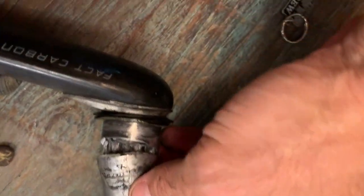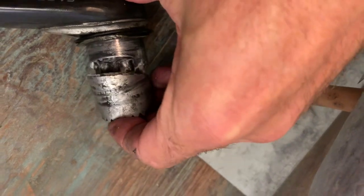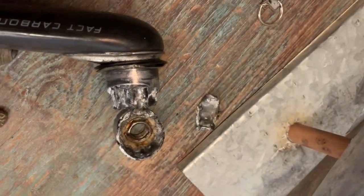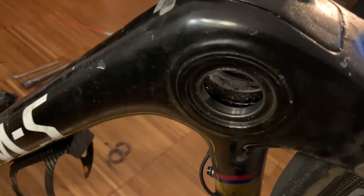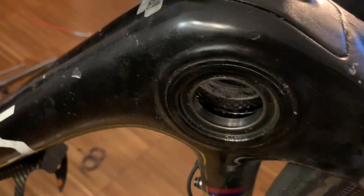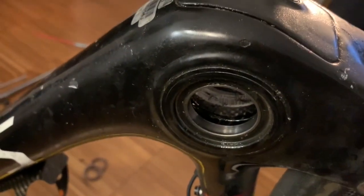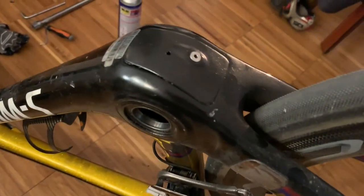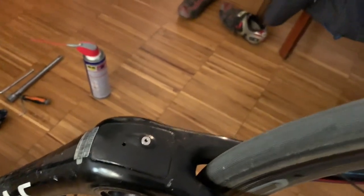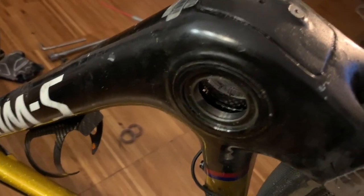These cranks are about three years old — around 45,000 kilometers — which isn't really what you'd expect. It was actually really hard to get them out of the bike because the bearings had been pulled out of true, so they were very stiff. I used my press tool and pushed them back in, and they became straight and seem fine now actually.